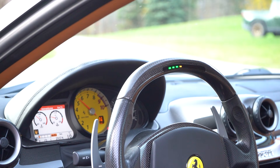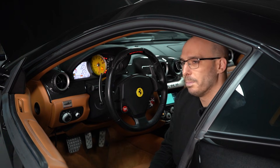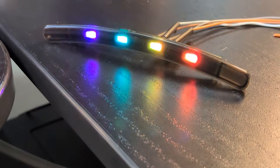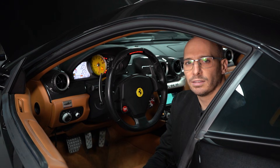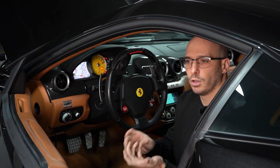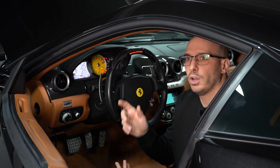It just kept snowballing. After getting it to work on the factory RPM, we also have turn signals — if I turn the hazard lights on, it does this cool blinking effect. But I wanted to do more than that as well. There's a mode now where it can take in messages from the ECU and you can do custom patterns and lights. And the next step was: how do you adjust it without having to pull the airbag off every time? So on the main board I ended up putting Wi-Fi so you can use an app, and you can go in and select what RPM you want each shift light to come on at and what color you want each pattern to be.